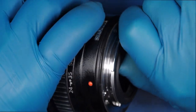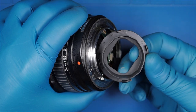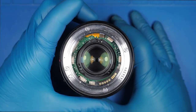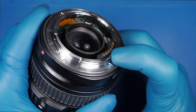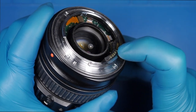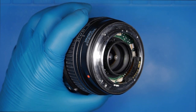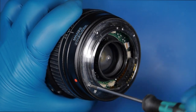We also need to take this cover off. It's enough to use your thumb, put it inside and lift it. It might be a bit harder than it looks in the video because this is not the first time this lens has been disassembled — there's some glue on the cover. You need to release the contactor, the mount connector. And next we're going to need to take off these four screws.